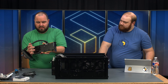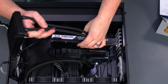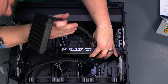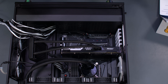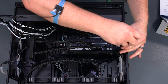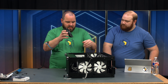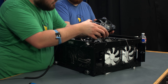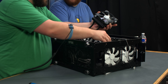To install, open up the slot on the X16 and just slide it down in. Rest the radiator there for a second, then secure the graphics card to the case before trying to put the radiator in so it's not moving all over the place. For the radiator, generally line things up beforehand because you're going to be putting a screw in through the fan to hit the radiator and screw into the case.